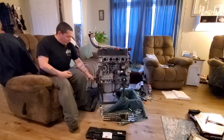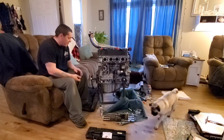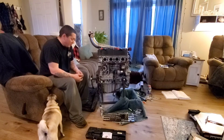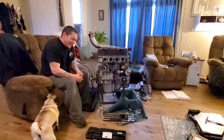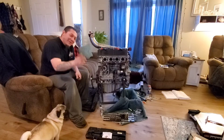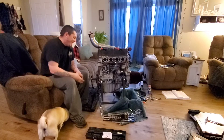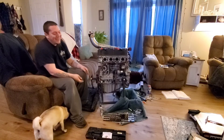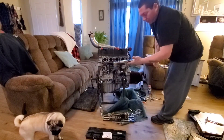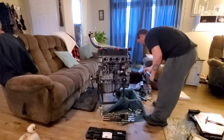You do have to put a breaker bar on the front — it's a 19. I'm going to put a pad down on the floor. I've got this Harbor Freight digital torque wrench — this thing's pretty badass, half the price of a Snap-on. Right now I'm just looking to get to 30 first, then I'll bump it up.